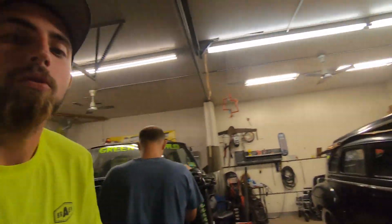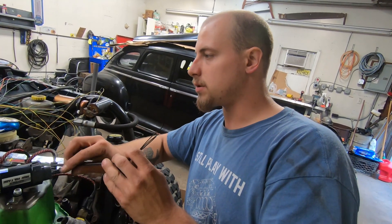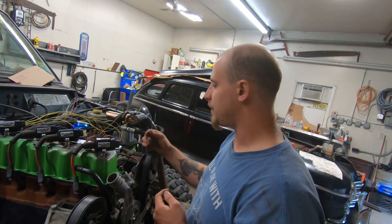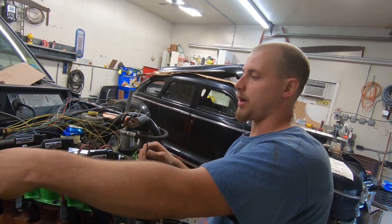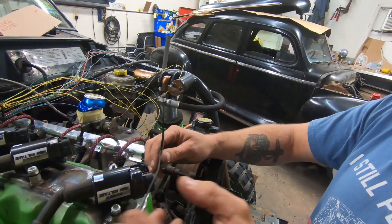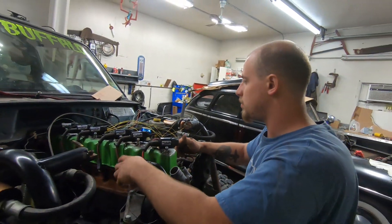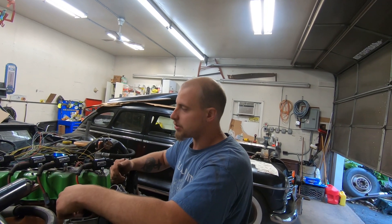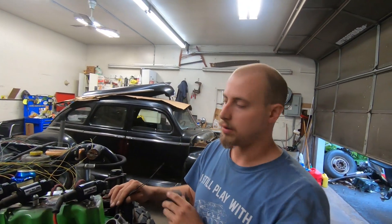Welcome back to another episode of the Gruesome Garage. It's another beautiful day, raining as usual, but can't complain. We're getting ready to wire up some coils. We have five sensor grounds left — I used one for the coolant temp and I'm probably going to split off. The coils are going to share a sensor ground each, so we're going to use three of the five sensor grounds. I need one more for the cam position sensor and I'll leave an extra one just in case we add flex fuel or something down the road.